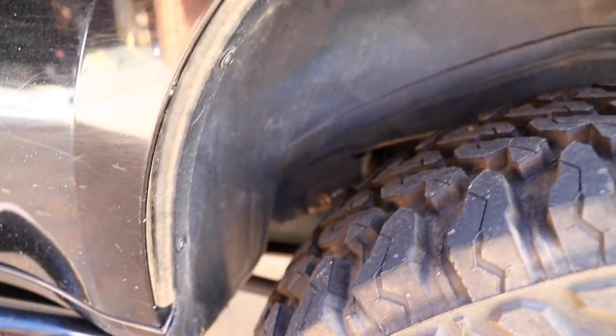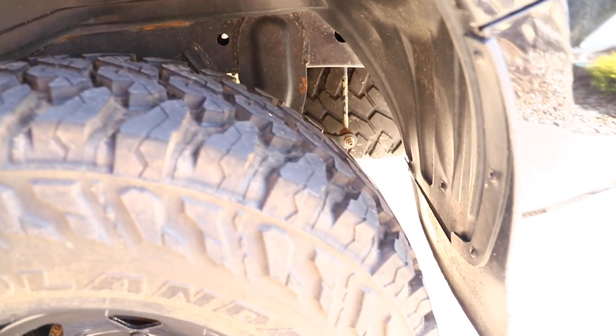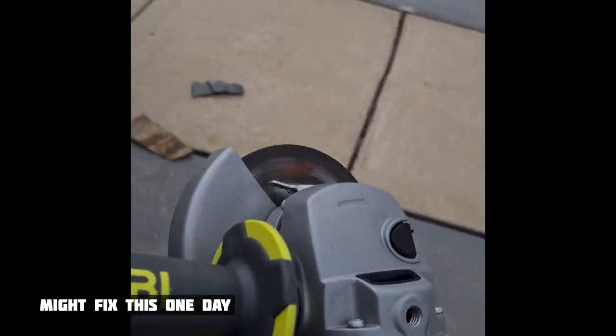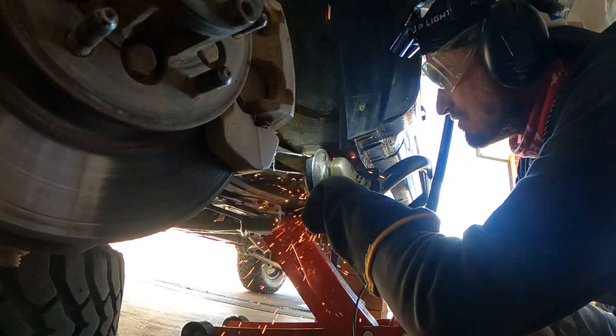The rears on these rims, so positive 20 offset, fit fine. No trouble at all, no scrub, nothing. The fronts though, they needed a bit of work. There's a liner in the wheel arch that wasn't properly seated into the bull bar kind of thing, so it sort of stuck out a bit. I had to cut that off. Mud flap I've taken off. I haven't actually put that back on yet, but probably everyone knows when you want to put 33s on, you have to do a bit of cutting.